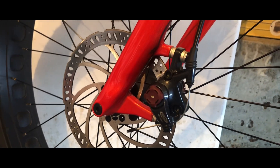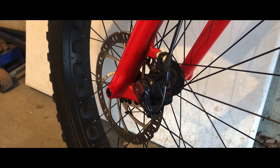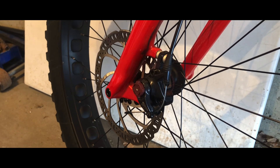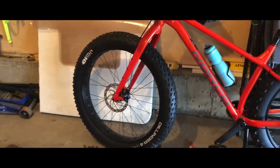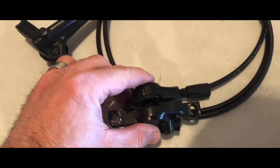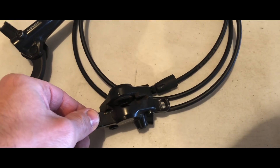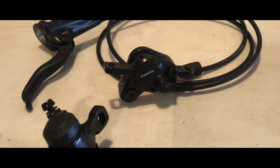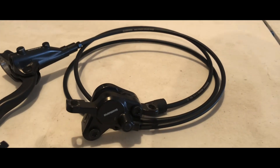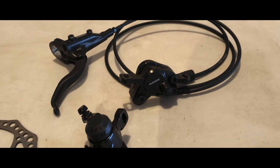For a trail bike I'd rather have a four-piston brake - they just seem to bite better and stop better. Hydraulic fluid is fine in the summer months. With the hydraulics, there's no adjustability but you'll need to bleed them every once in a while and make sure the fluid's clear. So this is my progression from cheap mechanical, to entry-level mechanical, to entry-level hydraulic, to high-end mechanical. If you have any questions about brakes, feel free to ask - like, comment, subscribe, thanks for watching.